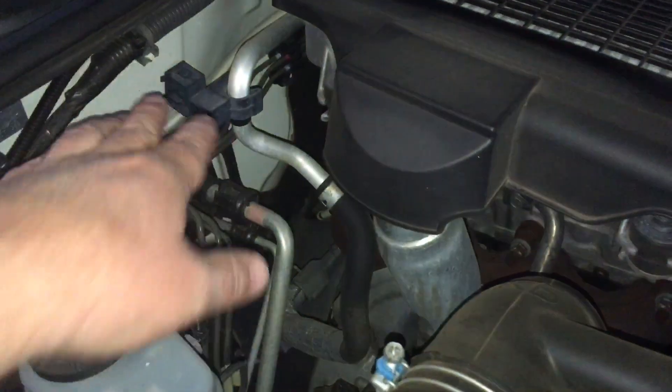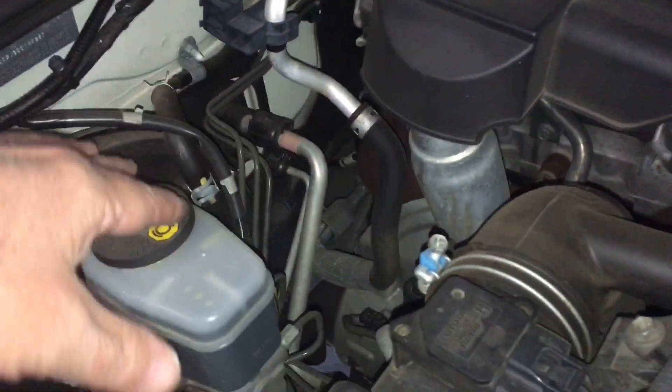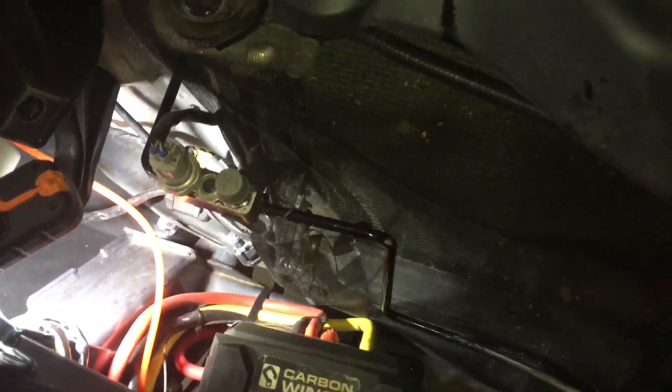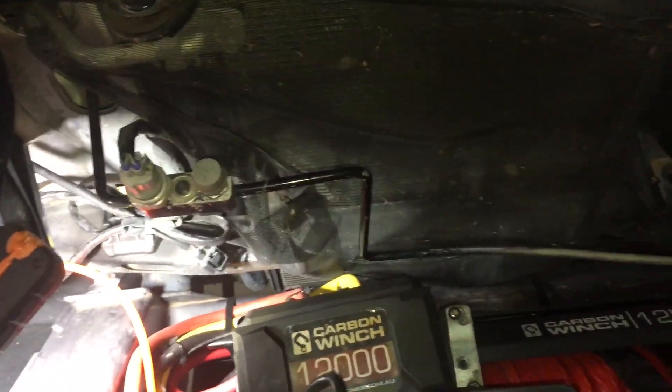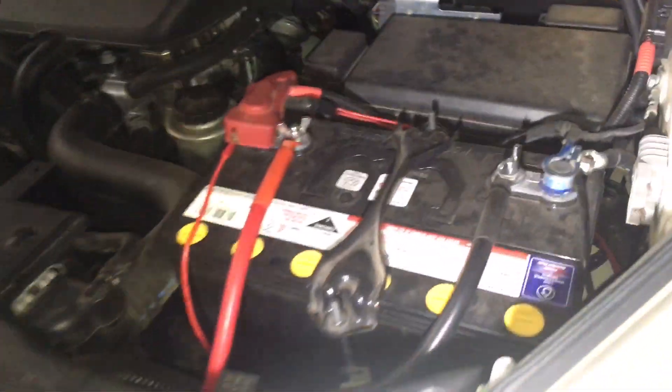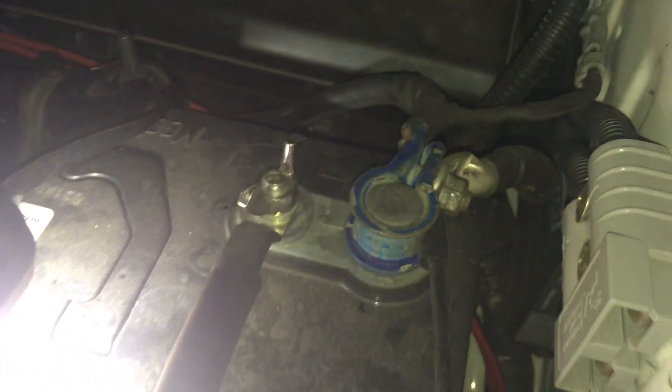So many people get lucky, but we do have vehicles come in - people run the wire for the dual battery around the back and don't secure it, and it rubs through on hot things. I've seen all these wires that are burnt and I go 'I know what happened here.' I ask them and they say 'yeah, how'd you know?' If we've seen a few come in, there are a lot of cars we don't see.